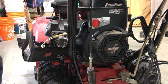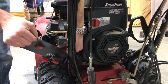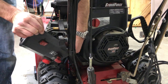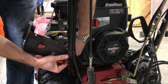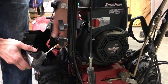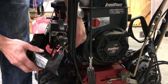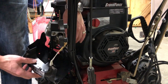We've got a couple of different wire hookups to pull here. There's the kill switch at the bottom — or the safety switch — so your kids don't start it up without you being around. And then there's also the stop/start switch here. Both are on the left side. I'm going to go ahead and mark these, otherwise we're going to get them backwards and it'll never run again.